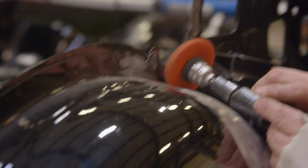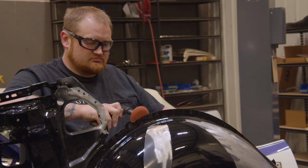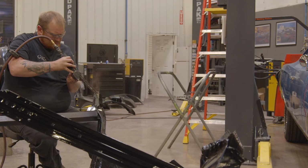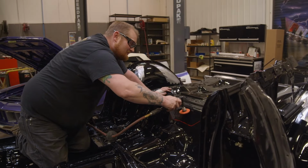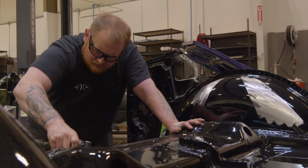Now, before we can actually put the roof down, we have to prepare the areas that we just got through painting for welding. So when the roof comes down, the roof inner structure pieces, the ones I don't make anymore, are going to intersect with the inner wheelhouse. That's all got paint on it now, so we need to grind that paint back off the roof piece. Wherever there's an intersection, whether it's where the quarter panels meet the roof inner structure, the Dutchman panel meets the rear wheelhouses, the A pillars meet the A pillars, B pillars meet B pillars, all those areas, if we're going to do welding on them, we have to go back through, clean all that paint off in those intersecting areas, and put some weld-through primer on them.